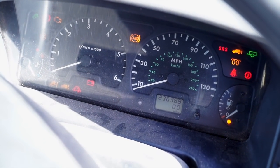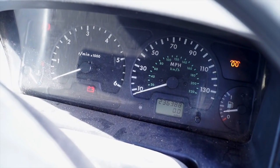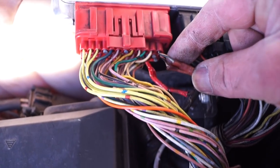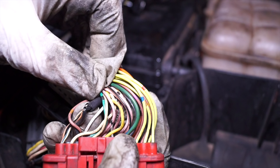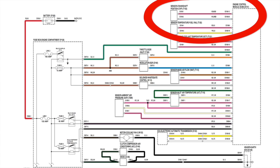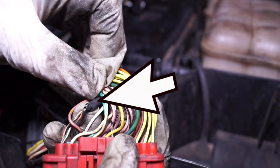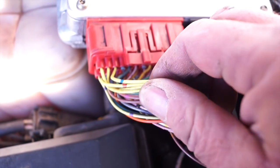We're still in a non-start situation — she's cranking over without firing up at all. With this sort of diesel system, it's either going to be electrical or fuel-related. We found broken wires on the wiring for the CKP, which means crankshaft position. Looking at the wiring diagram, this goes directly to the ECM. You can see the wiring colours and it's screened by heavy insulation. On this plug you also have the injector pulse wires, which are yellow.